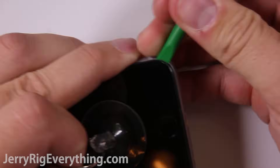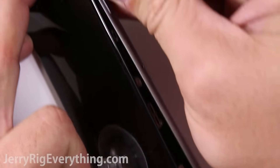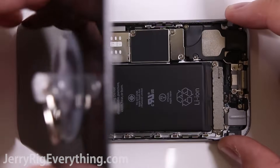There is adhesive surrounding the outside of the phone. I separated that with my plastic pry tool and then the screen was able to just lift up away from the body. Be very careful — do not bend the screen up past 90 degrees.